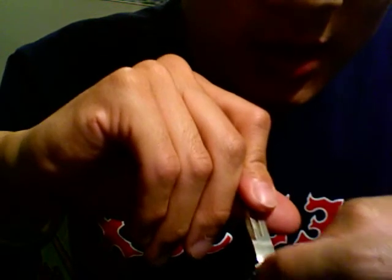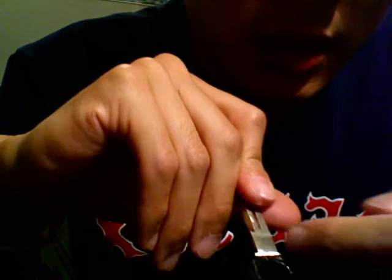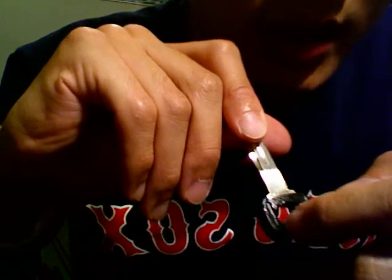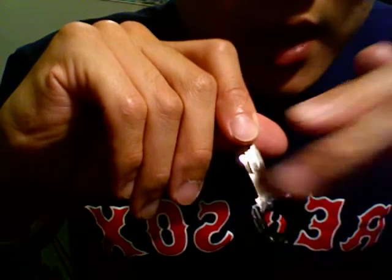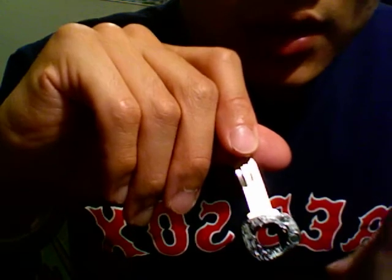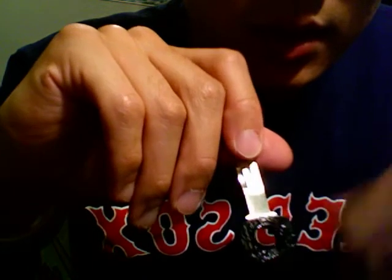You're going to want to put it in sideways, and it's going to stick up a little bit, and you need this entire surface area to be flush so that it swings. If it has a little bit of a bump, it's not going to swing easily. So that immobilizer head that's sticking out a little, that corner needs to be shaved off. So just get some sandpaper, shave it down, and then you can grease up the area again with some silicone grease or whatever you guys want to use to once again get that slick so that it'll flip out easily.